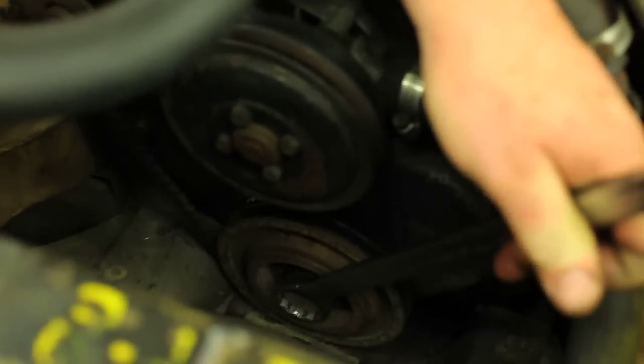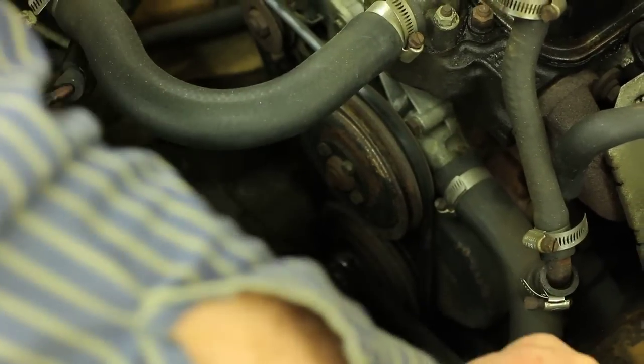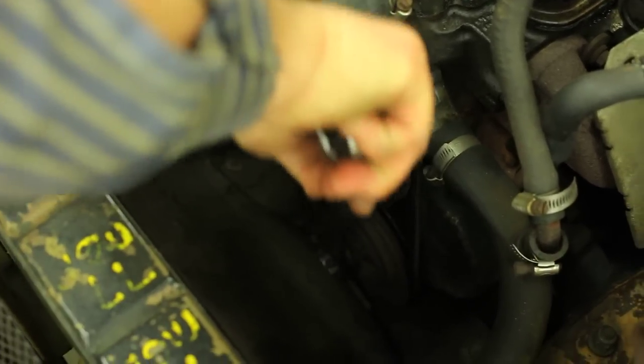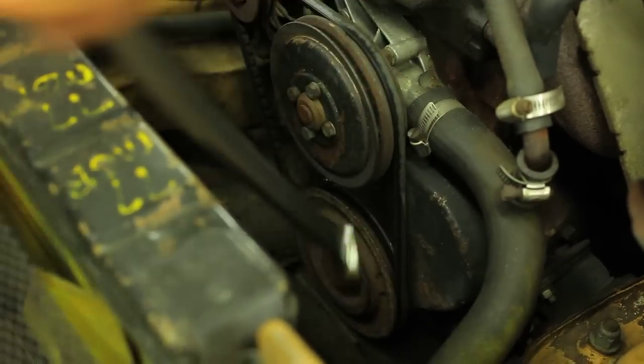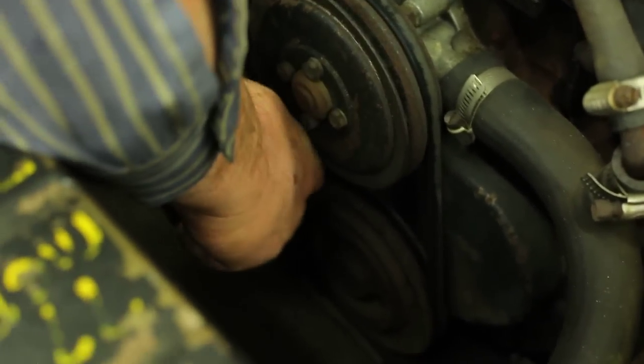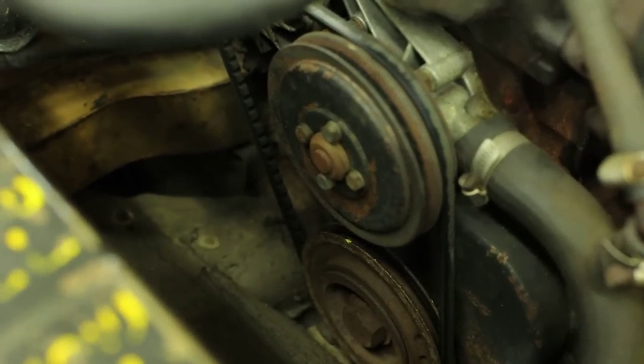Then we're going to turn our front crank pulley until we find top dead center. I notice the engine's in gear as I'm turning, so it's moving incrementally. We're looking for top dead center here, and I will find it. I've probably been around almost all the way once. Feel it to make sure — yes, that's it. And I'm going to put a little mark right here. That's not top dead center yet. Remember the engine moves in the clockwise direction. So if we're approaching it from an anti-clockwise direction, we have to go past top dead center, then come back to it.